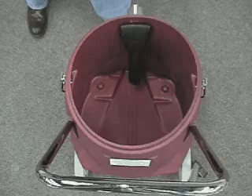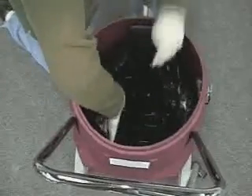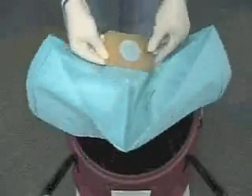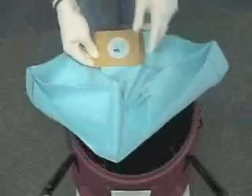Fully open the plastic bag and insert it into the bottom of the 15-gallon tank below the down tube intake. Take the paper collector bag and bend back the cardboard ears so you have something to hold on to while installing the rubber collar over the down tube intake. Pull some of the plastic bag around the paper bag.